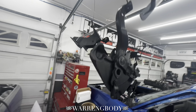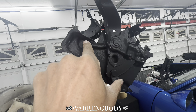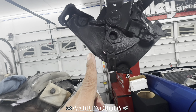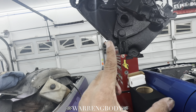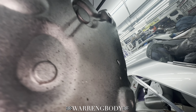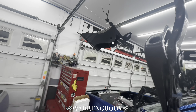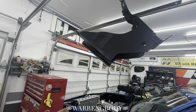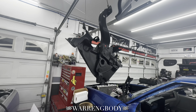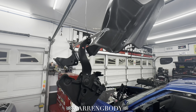Quick fade in — I went ahead and sprayed these. I wasn't even supposed to spray all of this, but I got the areas where the bolts are going to go down — there's tape down in there, because I need that to stay bare metal so it can ground it out. And where the little switch goes, I got tape covering that up so it can ground out correctly. The back I will clean back up to make sure it's bare metal on the back so it grounds out. I just put some U-Pol Raptor on it — that's all I had here. These are the parts that are up underneath. And it is way too cold in here to be spraying stuff, but it is what it is. The sandblast looks good, should bite on there nice.